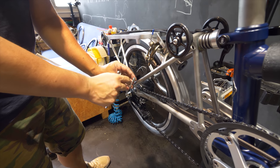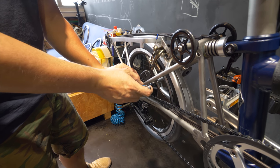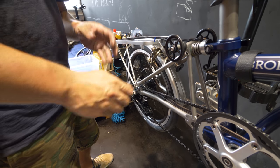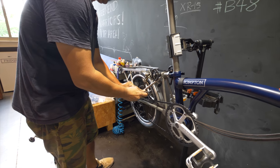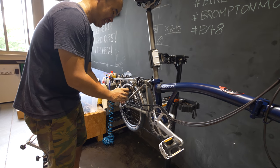Last time, the bolt that tightened the shifting cables here was a bit loose. That's why I lost the gears — when you pull, it's not pulling anything. So you were on the hardest gear, literally. You had a barrel to ease it up — apparently pedalling hard at 2:30 a.m. Now it's fixed. It was supposed to be a nice cool ride back home, but we essentially had a fixie. Things do happen.